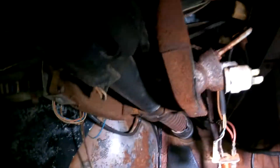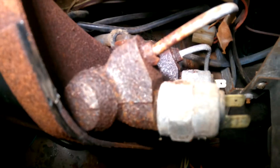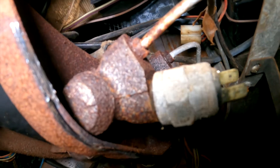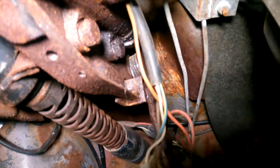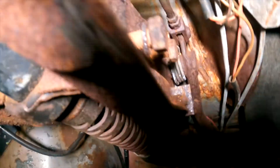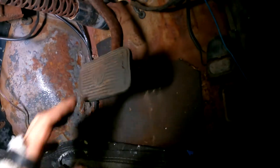Update: I sacrificed the heat shield. There are two brake pressure switches, and the lines come up on the side — both pretty rusty. I may have to cut the brake line a little bit back and splice in a new piece. The reservoirs push in from up top, kind of like a 914 style. My main worry is that clevis on the back side where the brake pedal pivots off this cantilever. Success — I got it out! The push rod is going to stay because there's a snap ring way in the back with zero percent chance of removal, so I'll just leave it and swap the master cylinder.